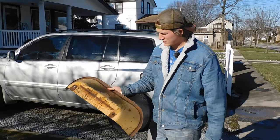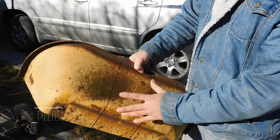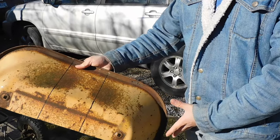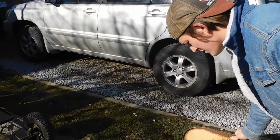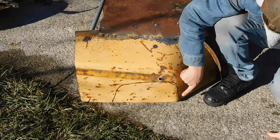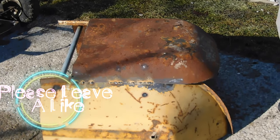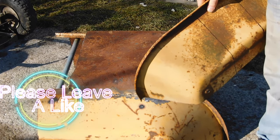We marked out the fenders for the bed. We're actually going with five inches instead of four because we want it to be more proportional to the bed. You notice on step side — this was almost the same length — and we just want it to look normal. We also drew the fender here for the front fender, so I'm gonna have to cut this out and weld it back together, then get to mocking it on the bed and mock this side for that side.